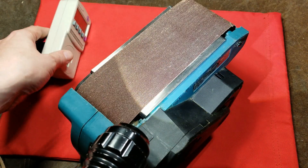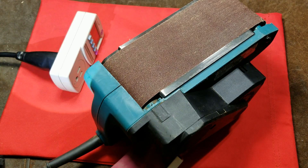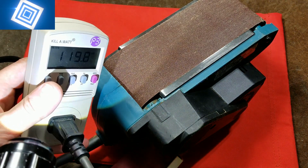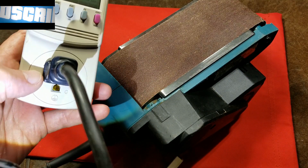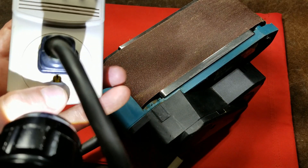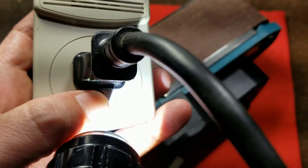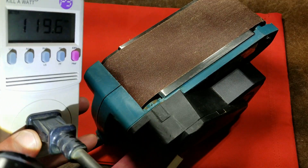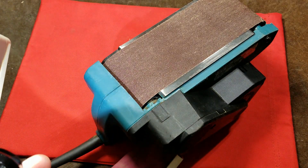It's pretty easy to tell when something goes down by a third, but it's always nicer when you have a real tool. Let me get this all plugged in. I have my handy flashlight because the alignment of the LCD screen is just not cooperating. I will say that the receptacle in this is surprisingly high quality — it's actually a full 360-degree contact. The receptacle isn't just a little metal tang hitting the side of the ground lug; it's a full contact, and the same thing with two tangs, one on each side for the actual outlet, and they're pretty firm. So let's go to amps here and turn this on.